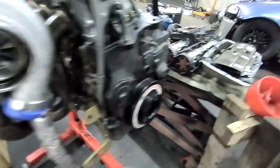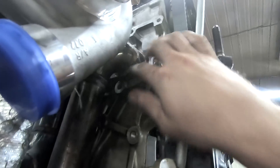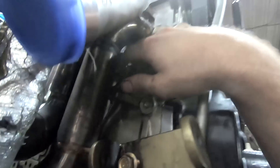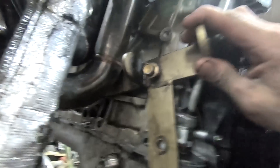Got Mario's all back together - everything's tight, pan's on it nice and clean, timed out really well. Next thing is once Sean's done mounting the catch pan and all the stuff on this one. Mario's had this problem where he didn't really realize until we pulled it apart this last time - this bolt right here, the manifold, all these bolts on the bottom honestly weren't all the way tight. The manifold wasn't flush because this is his alternator bracket and it hits right back in there.